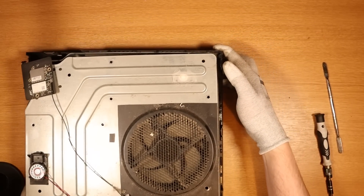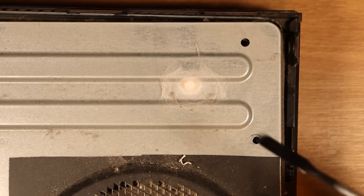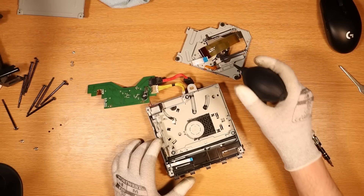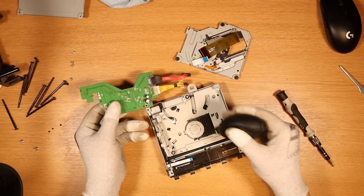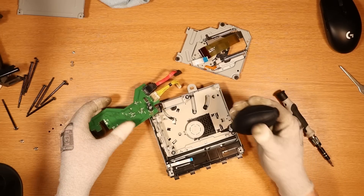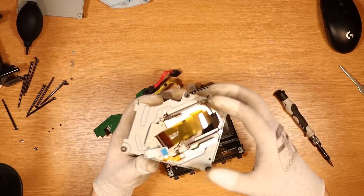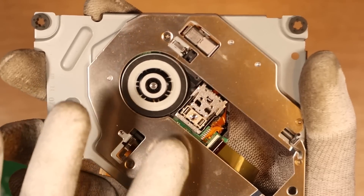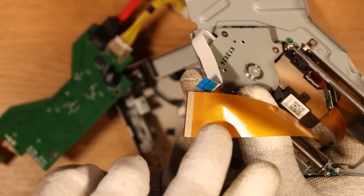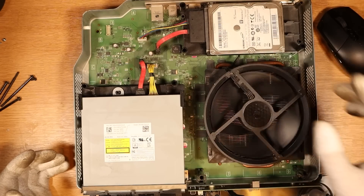I joked about finding a tarantula in a console — I'm pretty sure those are spider eggs. It's all web-wrapped with something in the middle; it looks like it's about to be born. I've cleaned out the Xbox. I've taken the laser out of the disc tray and given everything a clean with IPA and the air gun. The disc goes in and out fine but it's just not reading or showing up on the dashboard. That sounds more like a laser issue. I'm going to give it a clean with IPA and also clean the ribbon cable contacts. We have the exact same error — the disc just doesn't come up on the screen. I'm going to replace the drive.